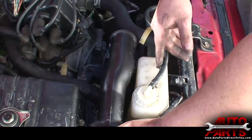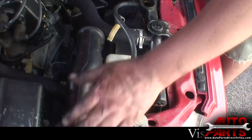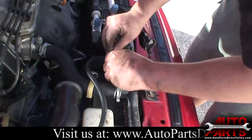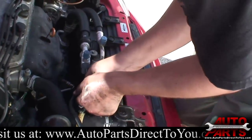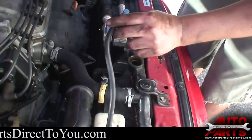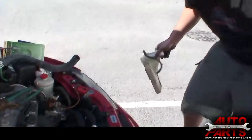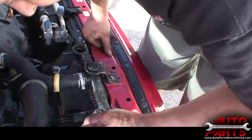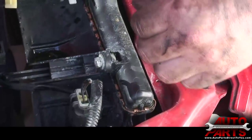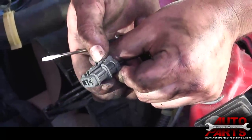First up on top is this little overflow bottle, which holds coolant — when the engine is hot, pressure rises and coolant flows from the radiator into the overflow bottle. It's held on with a little clip; use a pair of pliers to release the clip and pull it back. The rubber hose has probably been on there fifteen years so it may resist. The overflow bottle itself just snaps right in with a snap-fit design, so you can usually just lift it right out and set it aside.